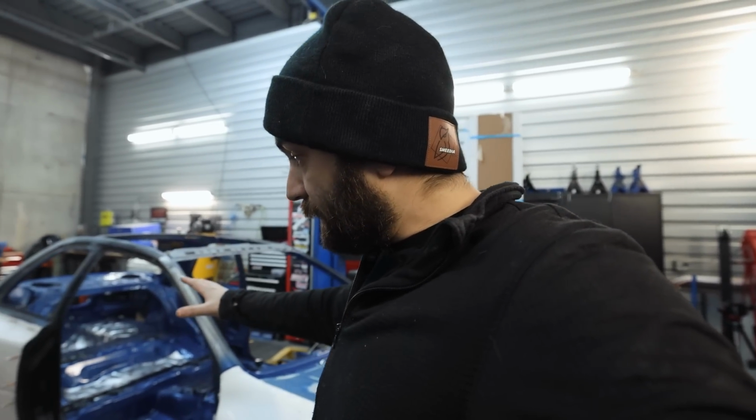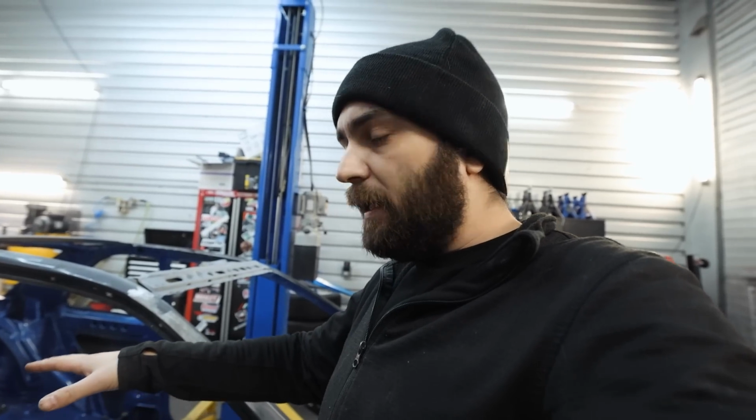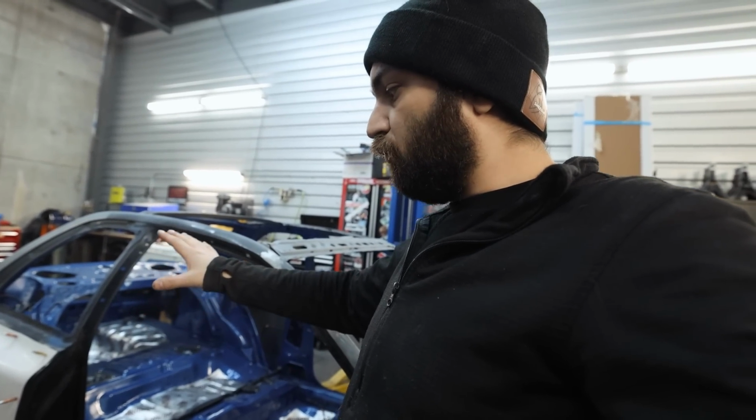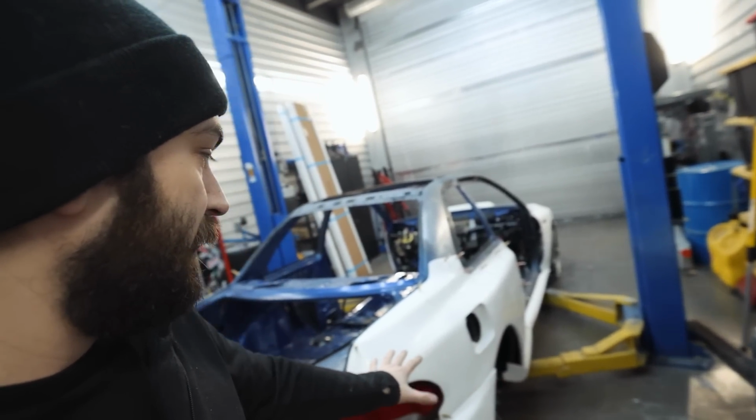So in the next video, I think what we're going to really focus on is starting to get the rear quarter panels cut, welded, primered. If we have all that, we can start really manipulating the rear quarter panel areas to really start fitting those pieces on, because once those are on and we have like a good happy point with them, we can start panel bonding them and molding them to the car, which is going to be the biggest thing that we need to do with this body kit, is mold these rear quarter panels on here.